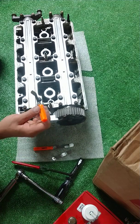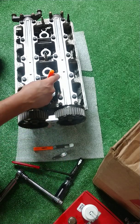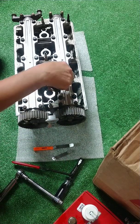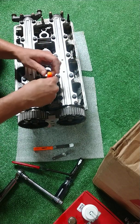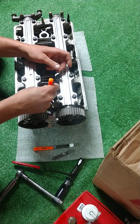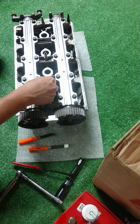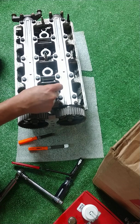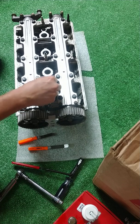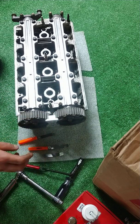Now, on the exhaust, 0.007 should fit underneath, the 0.008 not. There we can see the 0.007 is fitting underneath both of them. You don't really need to have the handle on. I just kind of slide this in, see if it'll go. And you can see the 0.008 gets stuck. That's stuck also. So I'm going to give you a visual of what's going on down here.